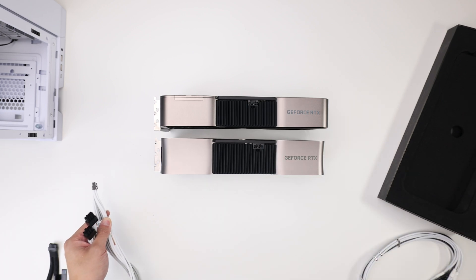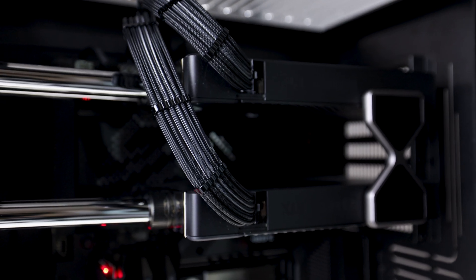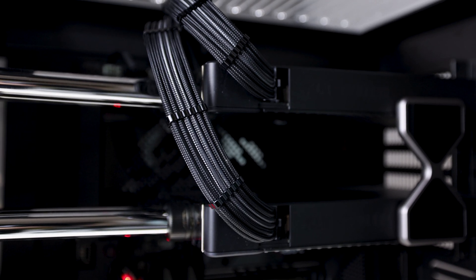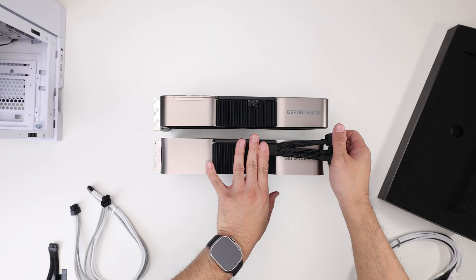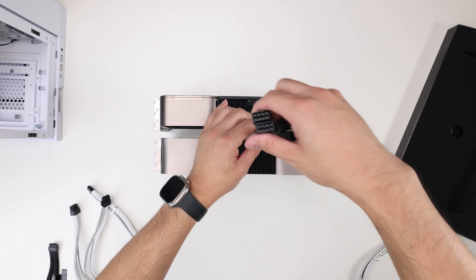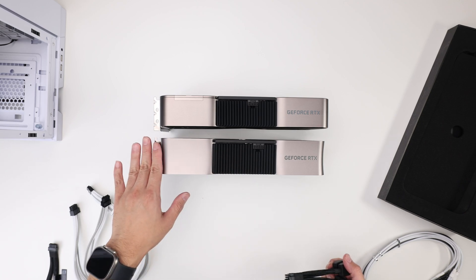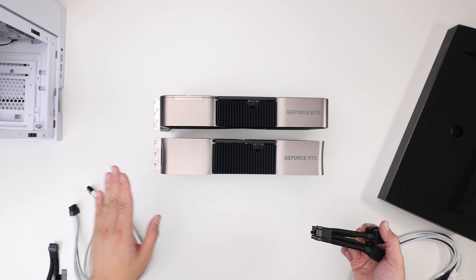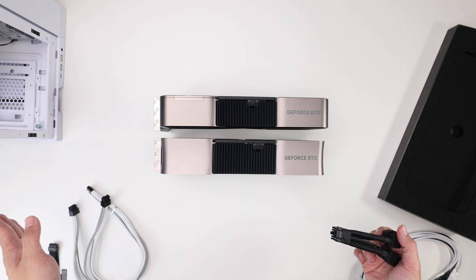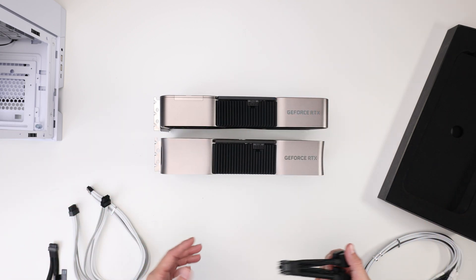The 80s and 90s had it rotated the other way. On my computer that has two 90s, it's rotated like this, and when you slot it in there's less chance of bending, simply because this is a better position to slot the connector in. The 4090 cards are big — some of the AIBs are even taller than the Founders. So a lot of folks are running into side door issues or just issues getting it in their case.